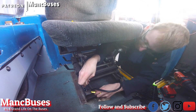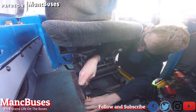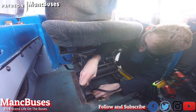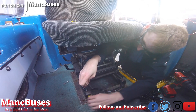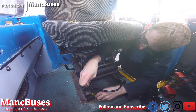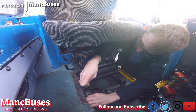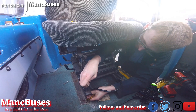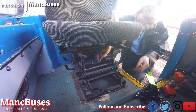When this goes back on, the shorter bolts are going on. What I'm doing now is removing the runners just so the seat is out of the way. Because it's part of the bus I can't actually remove the entire seat, since I can't get underneath, and I can't move the bus because it won't take power — the gearbox computer is completely shot at the moment. It's in the cabinet behind the seat. I've removed some screws to take the computer out and the connector, so I can check if there's power going to the connector.